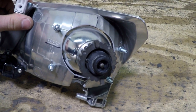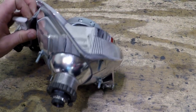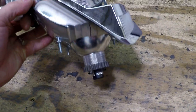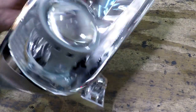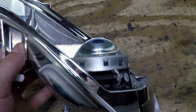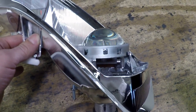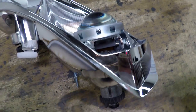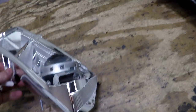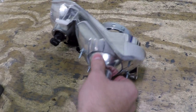We're going to fine-tune the alignment, so we're taking a different approach than most do-it-yourselfers. You can see the projector is fully recessed — that gives good shroud clearance, because on this model the lens goes over and out and it's a fairly large projector. The standard third-mount method is not going to work on these newer Civics with a larger body projector, which is why we need to recess it fully.